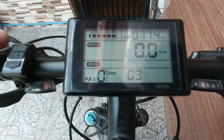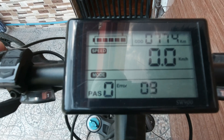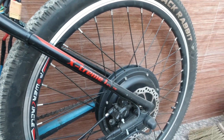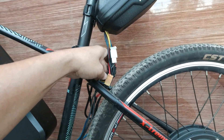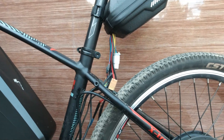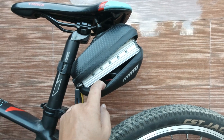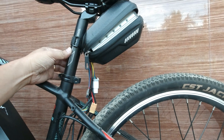I just happened to notice this while I was driving. The only thing I could notice is that the motor turns really, really hard — it seems that something is holding me back. I already tried to check the cables and still the error is there. So I think the problem really is the controller itself.